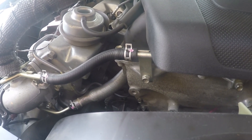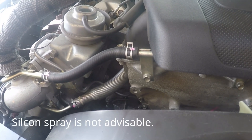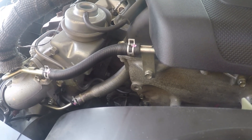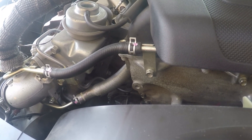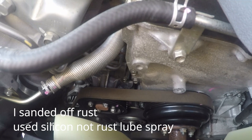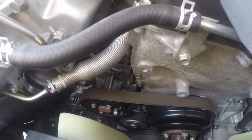What I decided to do was put a bit of silicone spray — not the heavy-duty stuff, but something with a little bit of lube — onto the pulley itself. I also noticed one of the idlers had a bit of rust on it, and that's why the belt is actually brown on the outside. You can probably see a bit of brown on the outside of the belt. I put a spray on that as well.